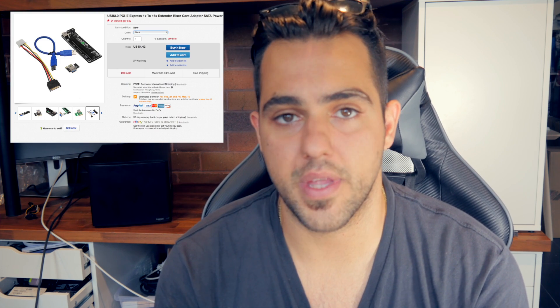Today we're going to be building a GPU expansion box. This would suit people who are using Octane Render, Redshift, Blender Cycles, or other mainstream GPU renderers. My need for this was I needed more horsepower and couldn't fit any more double-wide GPUs in my render system. I found these USB 3x PCI extenders, purchased some, done a couple of test runs, and was actually shocked by the very small loss of performance.